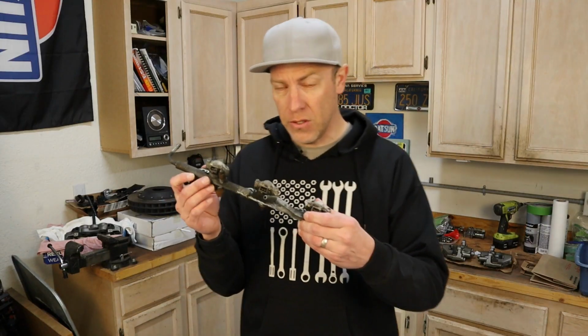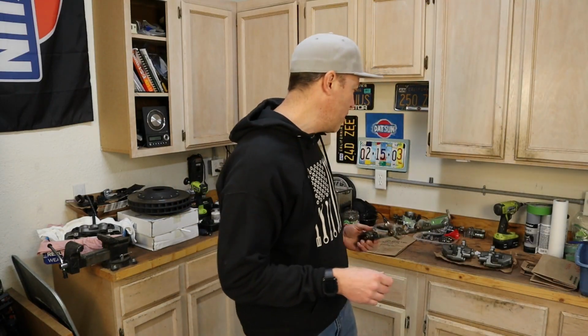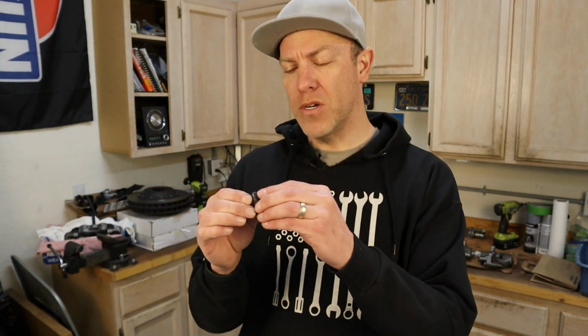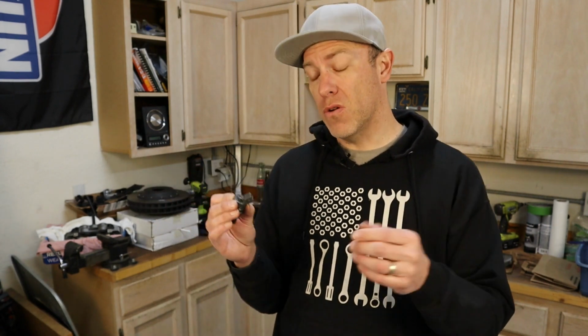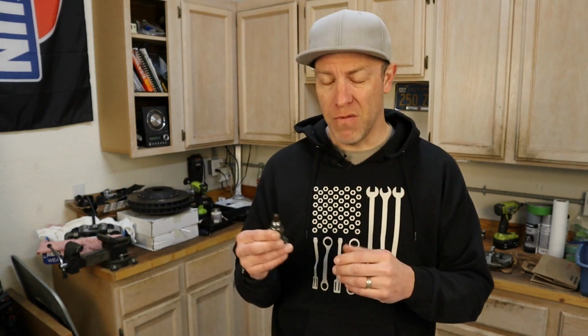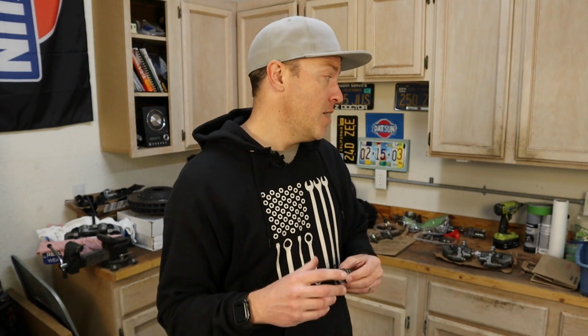We pulled the injectors, and after pulling one of the rails apart, we've got the Nismo 555cc injectors. They all test out as far as impedance, just looking across the two connections, making sure we're in range and they work. So what we want to do is clean these and then backflush them, and probably flush them back and forth, get them really nice and clean. We've got new seals for them, so we'll get those installed and we'll keep moving on.